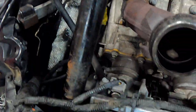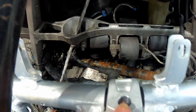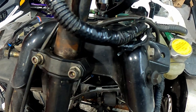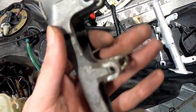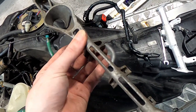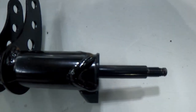I got the power valve bar removed from the front, and now I'm loosening up these two bolts for the steering bushing and taking out these two bolts for the hat - there are three bolts on each side for the hat. This bar has to go down to be replaced for the new steering shaft to slot down into it. So now I'm going to remove the steering hat and these two bars and work on removing the old steering posts and old handlebar setup. This is the old support where your pull cord comes up through and holds your four ignition coils - this comes out like the 2012 to 2015 Arctic Cats. On any of the FX and newer models when you go to the M or the Alpha setup, you get this piece which holds your lower steering posts.